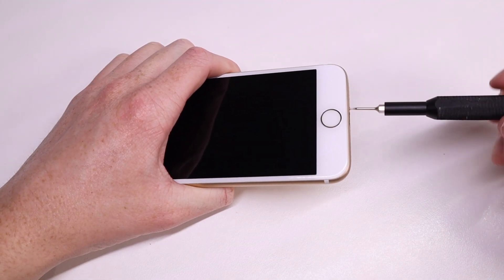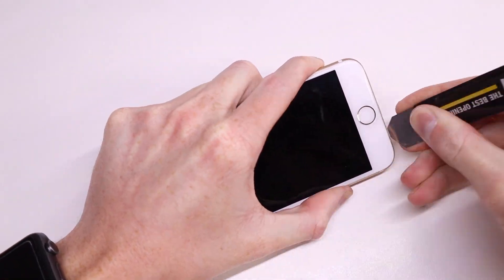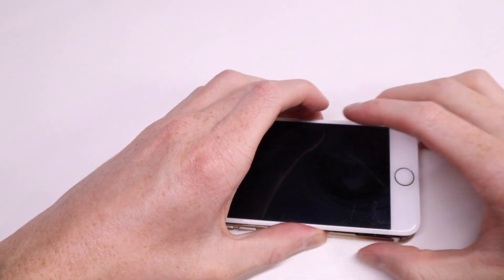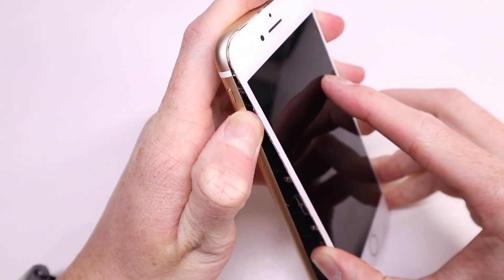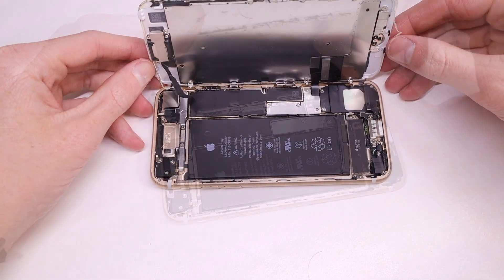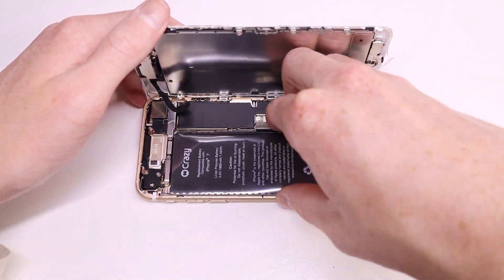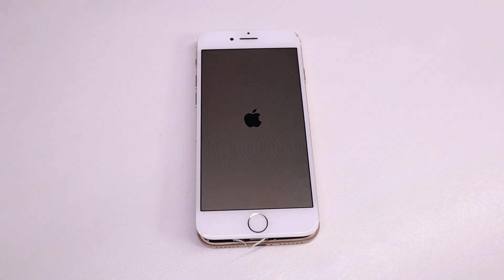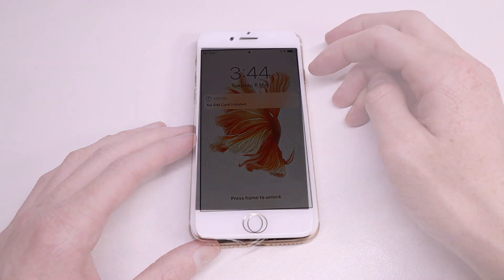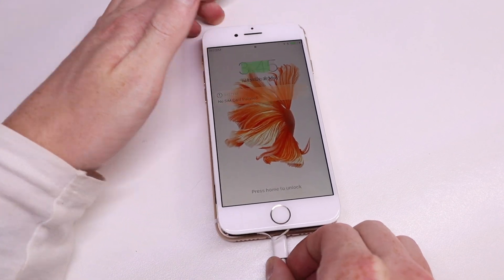To find out I'll need to open and diagnose the phone. I did try to open the display with some LCD pliers but that didn't work due to the waterproofing and dust seal that goes around the display, so I actually had to use a series of pry tools to get underneath there and remove that adhesive. You can see it is quite strong and that's because it's sealing the phone up from water and dust. Once I get the display up I can remove the four tri-wing screws, disconnect the battery, and connect up a test battery to see if the phone powers on. To my surprise it actually booted up to the lock screen but contained a password. Now that I know the phone powers on, I wanted to make sure it charged correctly, and sure enough plugging in a charger it seems to charge up the battery just fine.